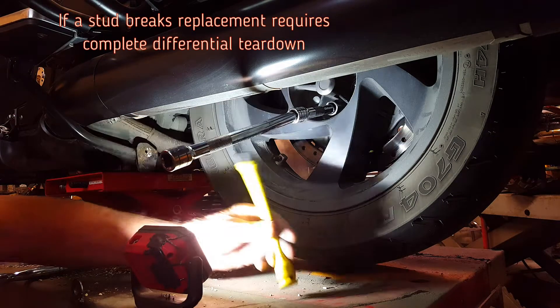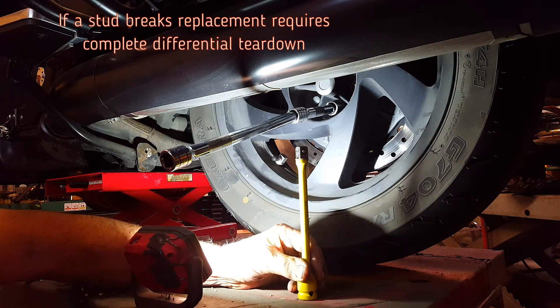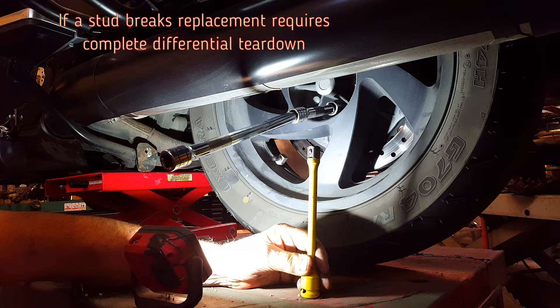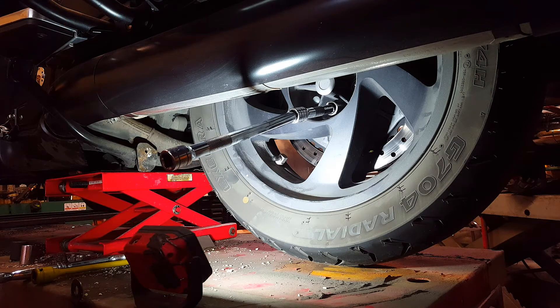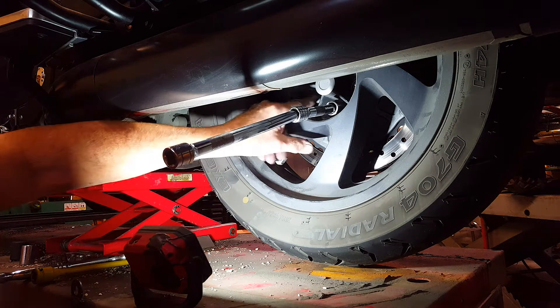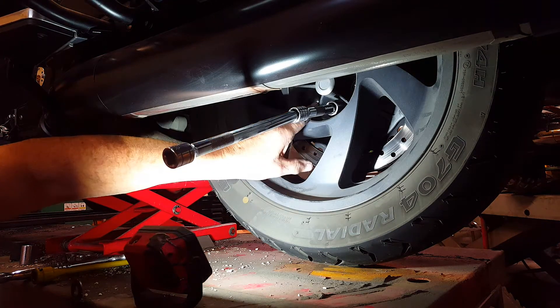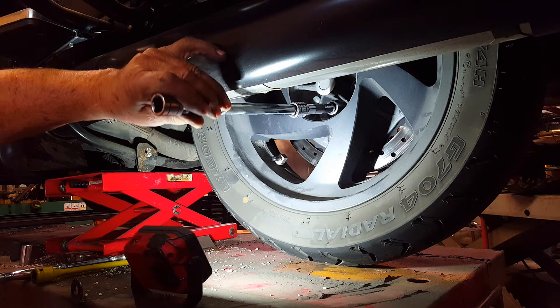I use a torque stick when I tighten them with an impact wrench — always 80 foot-pounds. If you don't use an impact wrench, you should at least understand what 80 foot-pounds feels like, or use a torque wrench. But the impact wrench and the torque stick is really the way to go because it's within a couple pounds. It's fast, it's easy. One of the problems with using a regular wrench is you put so much downward pressure on it you'll wreck the nut and could actually bend the stud. The impact wrench is nice because you get a nice straight shot at it.